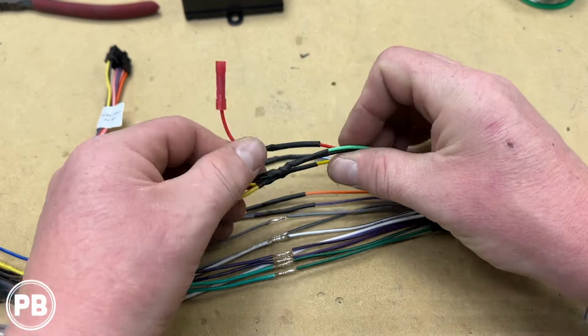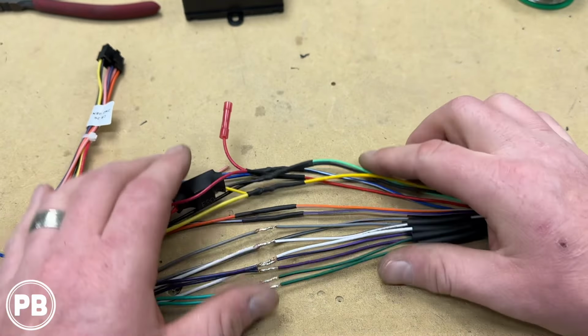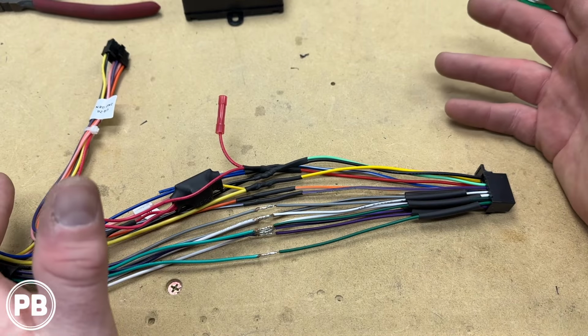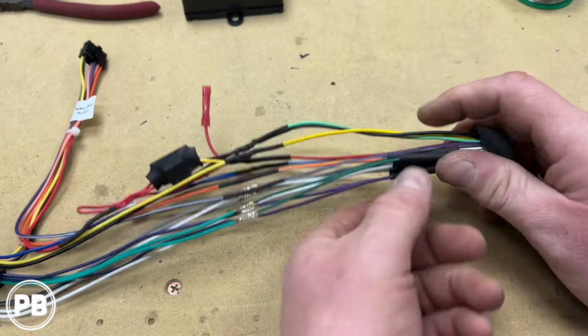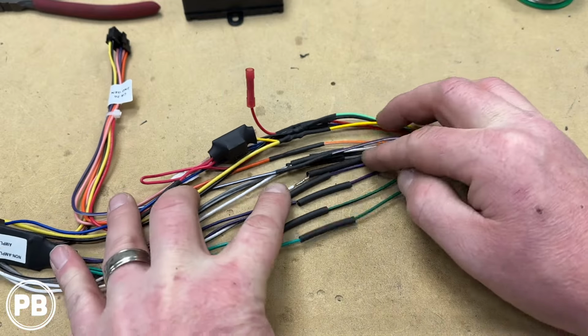For our ground, we added our parking brake wire to our ground. We can do that in Sonys. You can't do that necessarily in Pioneers or Alpines. You'll need some sort of bypass, and we can link that in the description or those videos that explain that a little bit more in depth. We finished moving our heat shrink up and over those connections, and we're going to go ahead and shrink them down with a heat gun.